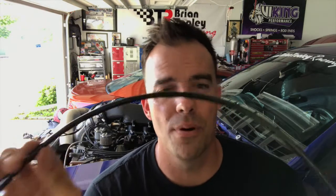That right there is rated to 200 psi of operating pressure — not burst pressure, operating pressure. It does have a temperature rating: as the temperature goes up, the line becomes weaker. The black line is pretty resilient; the clear stuff is going to be a little suspect. If you've ever gotten a methanol kit, this is usually the basic stuff that comes in a meth kit. Meth kits spray at 200-250 psi and they're spraying fuel through it, so if it's good enough for that, it's got to be good enough for boost control. I can't think of any boost control situation where 200 psi won't be sufficient.